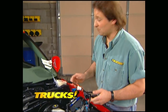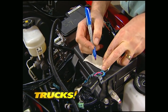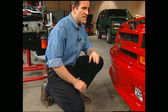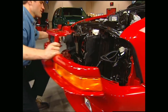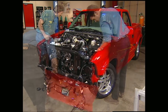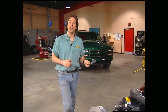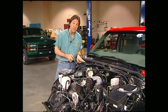Now you need to disconnect your electrical system. I like to take a piece of masking tape, wrap it around there — that way you can mark it and eliminate confusion when you hook it back up. While Stace was taking care of all that, I pulled the headlamps to get to the front nosepiece that's held on by spring clips and just pulls right off. After that, you can pull the bumper, then the fenders, followed by the cowl support. If you're working on a truck with air conditioning, make sure you take it somewhere and have the Freon recycled before you undo the fittings.